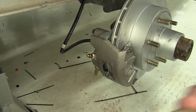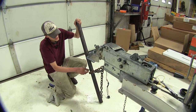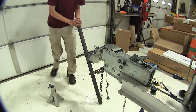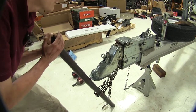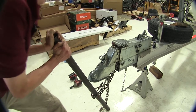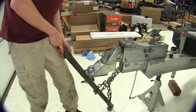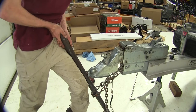Now we can start bleeding our brakes. You can take your safety chain here — it gives you a place to rest a 2x4 or metal pipe along — and you can push the tongue of the trailer back into the master cylinder. We begin the bleeding process by pushing back on the tongue, and we'll keep doing this until we have no air bubbles coming out of the bleeder screw on either caliper.